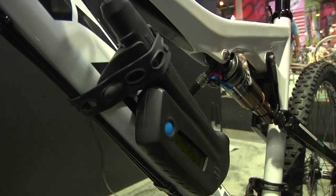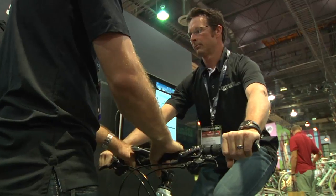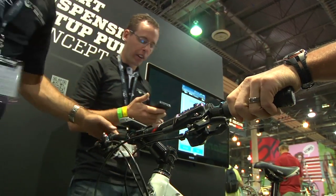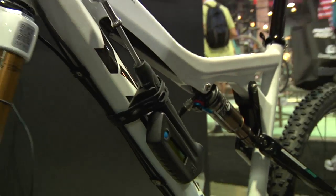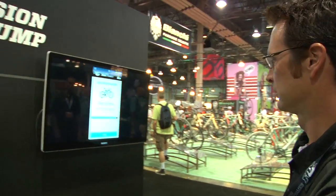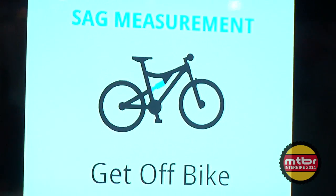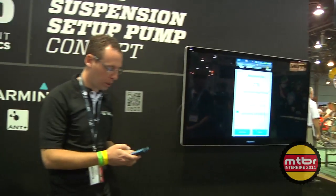Go ahead and sit. 30 percent — so we're a little too far in there. We want to raise the pressure up a few PSI. We're going to retest. 27 percent — all right, we got a lot closer there. If we wanted to, we could fine-tune, but we're going to continue on to rebound.